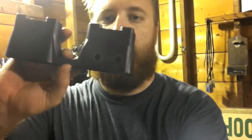The deal is, when you do this, you don't really want to give it the business, because you will break the cup. This is plastic and brittle and has been heat cycled 15,000 times, because this has 156,000 miles on it. So just rest the weight of the drill on it and wait for the hole to happen.